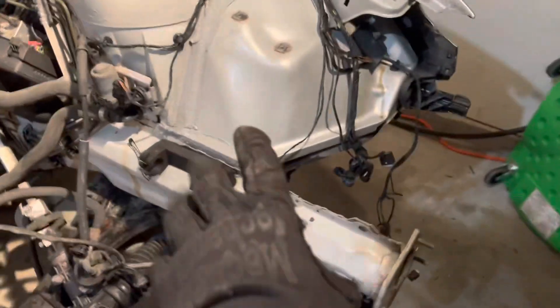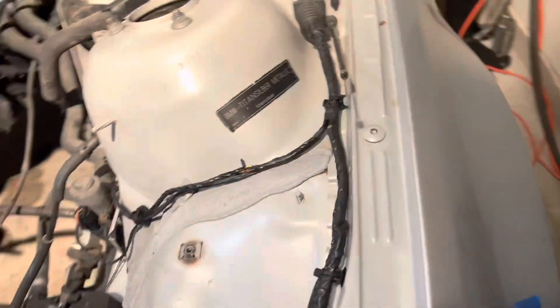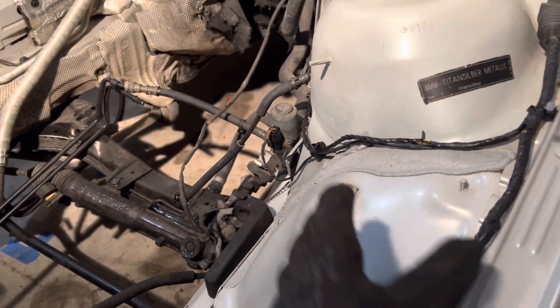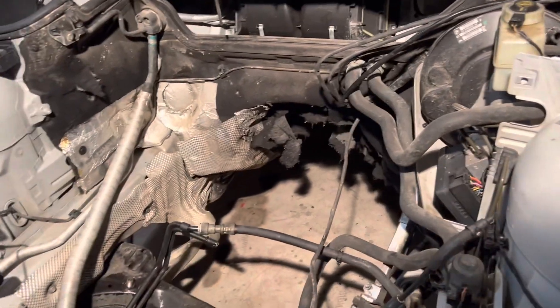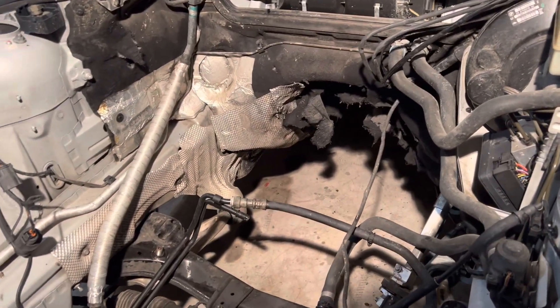I'm mostly concerned about the alternator — it really does stick out on these Corvette engines. I do think I might have enough space. I've been told by others that it might not fit, so I just want to test it because I do like the position of it. But if that doesn't work, I will go ahead and relocate it with a lower mount bracket. That's why we're doing this test fit, and it'll also help Wiring Specialties — the company I'm buying my harness from — know exactly what measurements to go with.